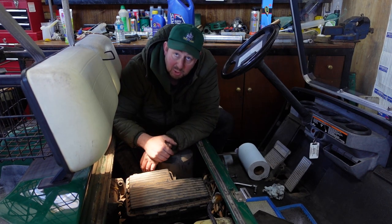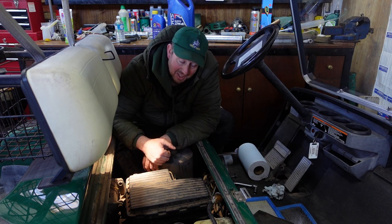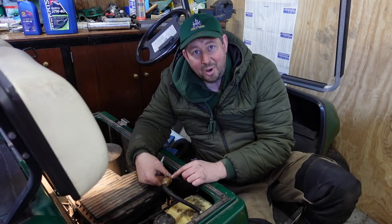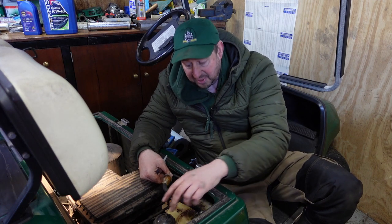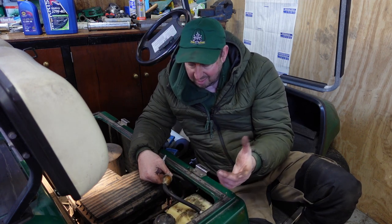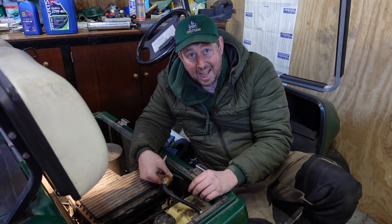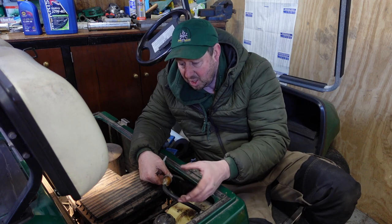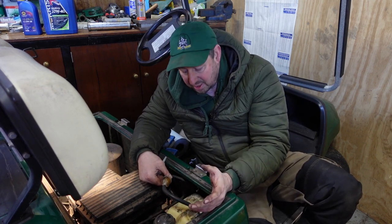We're going to change this fuel filter over here. That's easy as well. We'll get that done and then it's over to the spark plug. So let's crack on. I'll get the fuel filter out and we'll do that one next. Right, the fuel filter's located here. The job of the fuel filter is basically to filter out any contaminants from this tank of unleaded. We put our fuel in here. We very rarely take these to petrol stations. You're messing around with tins and cans and plastic bottles. So there is a degree of getting some impurities in there. But also, we're driving around in dusty and muddy conditions. So, you know, you need a sound and solid tank, really.